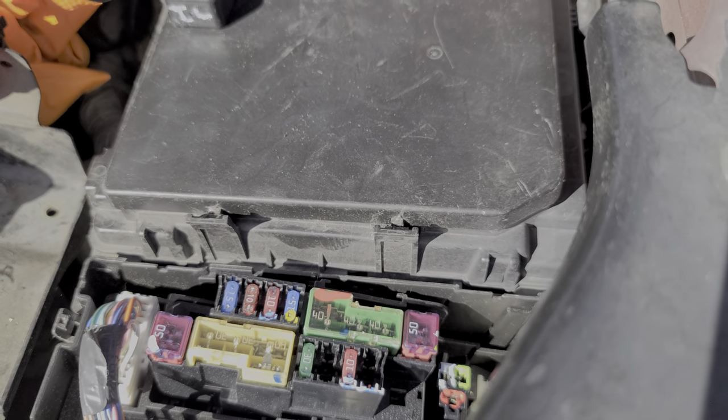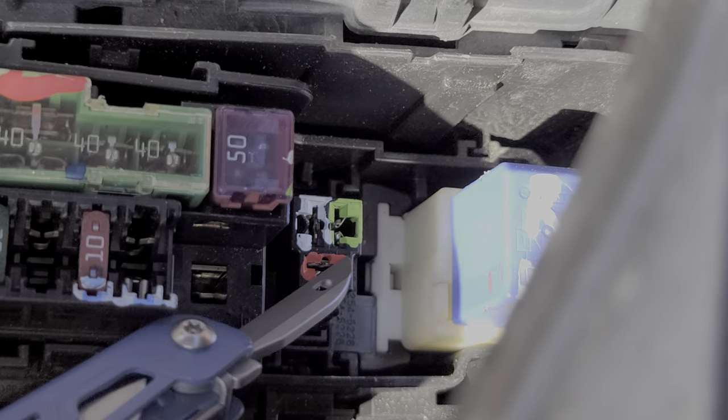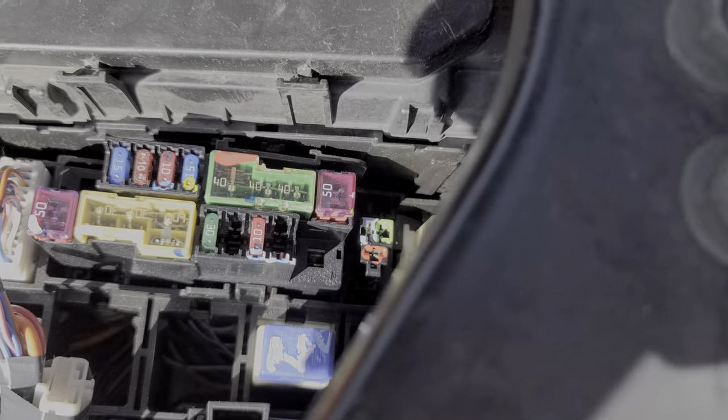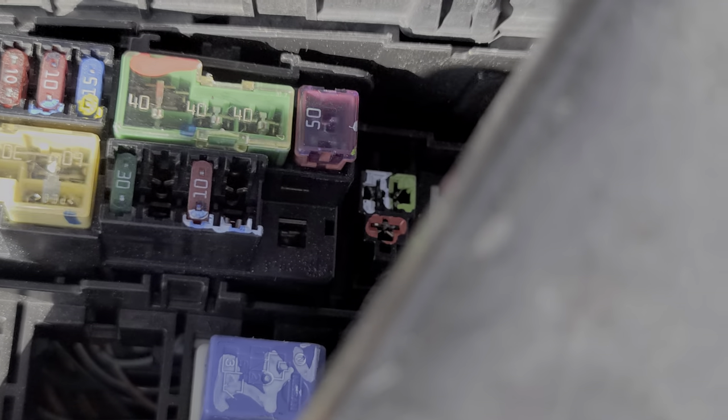This is an unusual three-pin relay — I'll identify each pin and tell you what it does. The 10-amp fuse provides power that comes out on the red pin. When you hit the horn switch on the steering wheel, a ground signal is supposed to come through on the green pin. The ground coming in activates the relay, which takes the power from the red pin and sends it into the white pin — the white pin goes to the horns. You can test the horns by providing your own source of power by shorting out the red pin and the white pin using pliers or a paper clip; touching those two pins together should result in the horn going off. You can also provide your own source of power into the white pin directly.